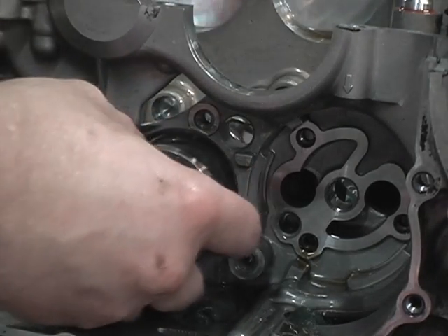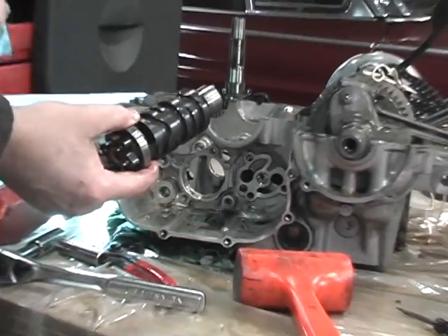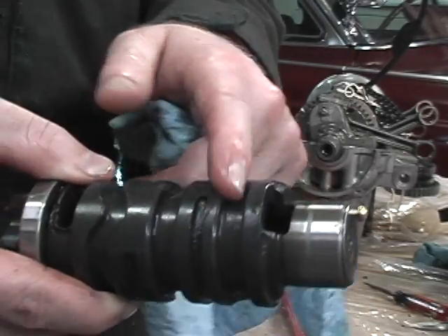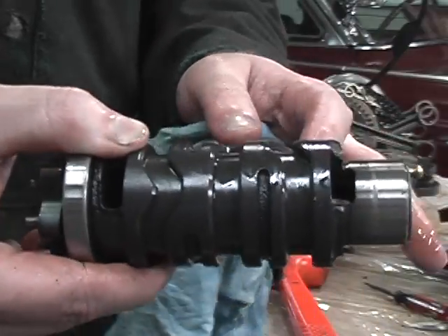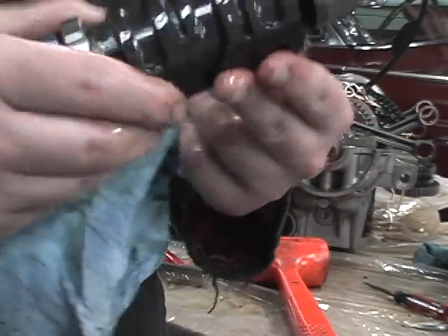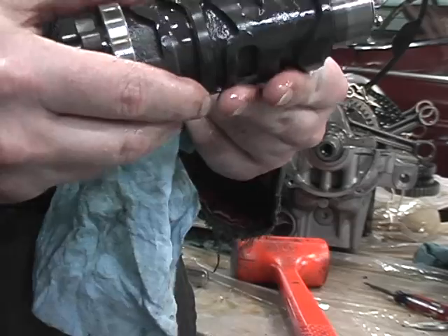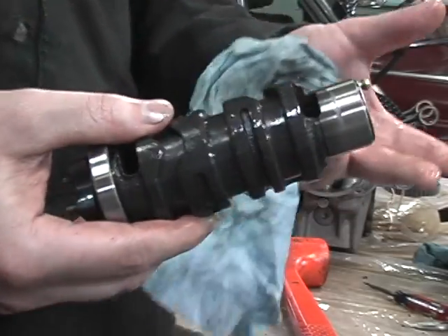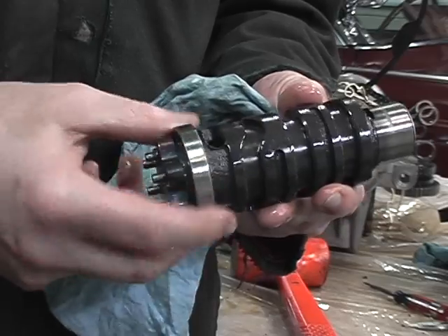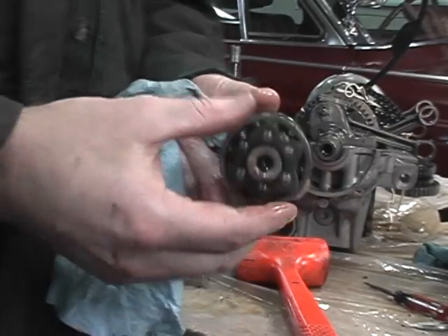The drum — you can push it through the other side where there's a bearing. Here is the assembly. This is the neutral sensor nub which goes against the electrical circuit. This track here is what moves the L shift fork, which is second gear; the other part is sixth gear. You just look in the tracks to see if it's overly worn. Mine looks really clean — not even a scuff mark. It's hard to want to replace it when it's $86, but you probably should since you're in here anyway. Most people debate this part — it's very difficult to determine one way or the other.